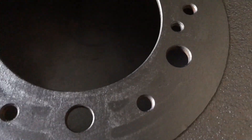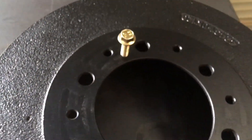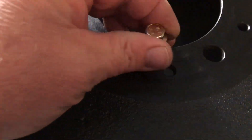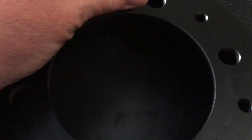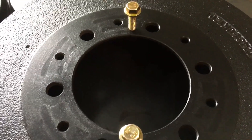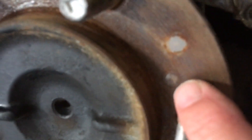What works really well - see there's a threaded section in there. Here's one we prepared earlier - it's got the bolts. So just go to the nuts and bolts section - it's just M8, pretty standard thread there. And as you do those up, just do it evenly. If you find yourself putting an extreme amount of pressure on these, there could be another reason why they don't come off. See that little mark there?